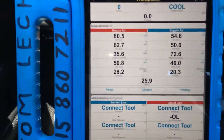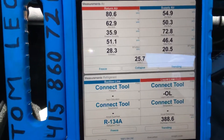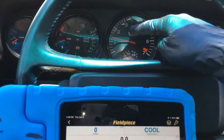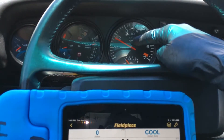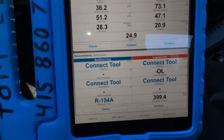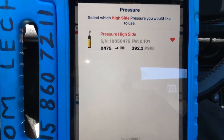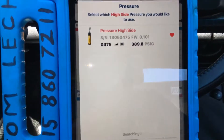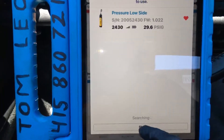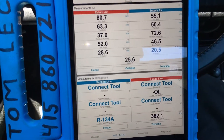Everything is wireless right now and for some reason I just lost all my connection to my sensors. I'm going to have to call up tech support. Let's go up to 2,000 RPMs. That sounds higher than 2,000 RPMs for a Porsche. That's almost 400 PSI — that is wrong. I don't trust that book. 29 PSI on the low side — that's too high. So I'm going to call that book, that Porsche manual, bullshit.